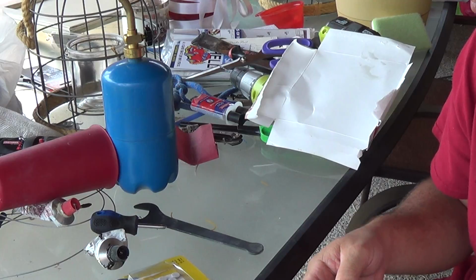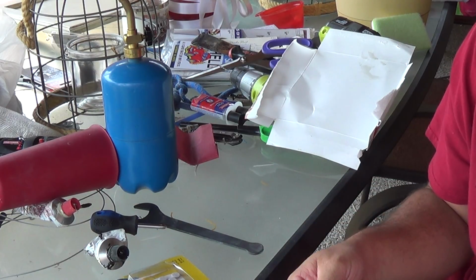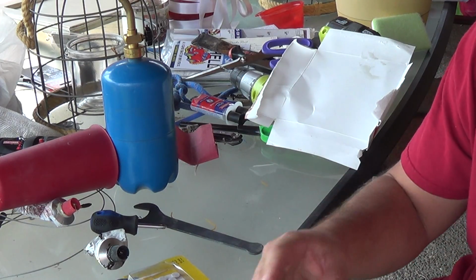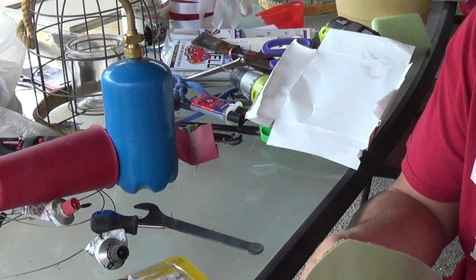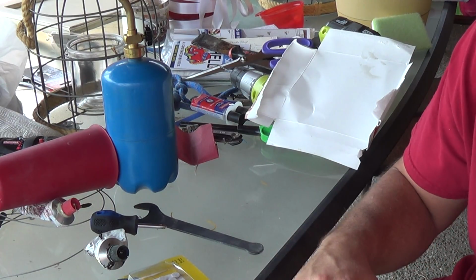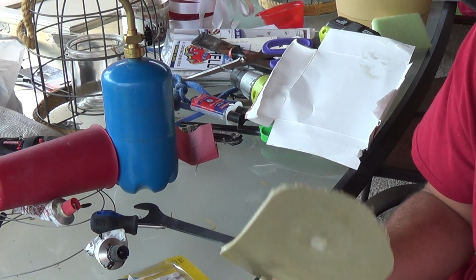The melting jobs, whenever you're melting this material with a propane torch or a heat gun, I've found it's pretty difficult to do. You have a very fine line between not hot enough and too hot. If it's too hot, this material will just melt and start sagging, and you've just ruined your boat. But this is a very strong repair that is not risking your kayak.